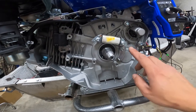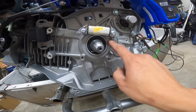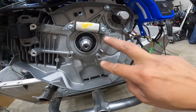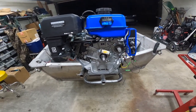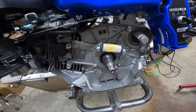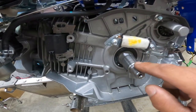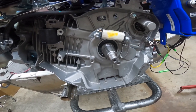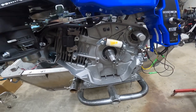People do add a second coil that mounts right here, tapping the brown wire, so now you have two coils going to that single wire and diode, which doubles your current output. But you're still limited because one leg of this coil is grounded to chassis, so you're not getting a full AC sine wave — you only get half a ripple, and just that half ripple gets rectified.